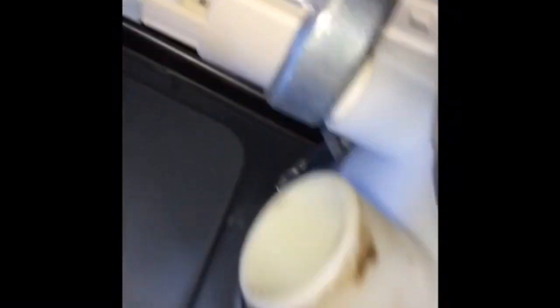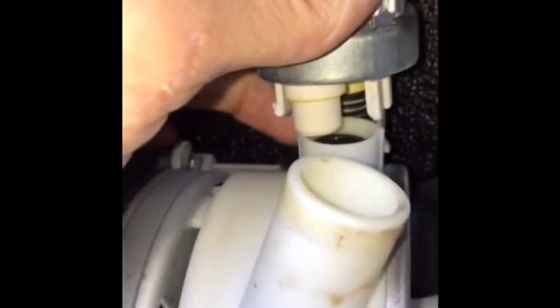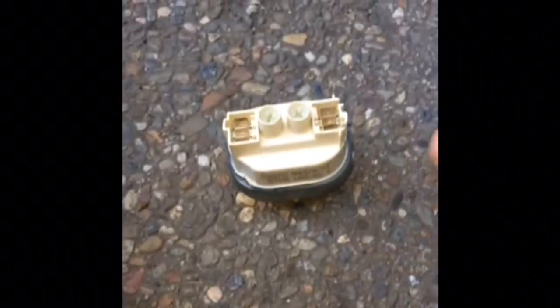With a little bit of pressure you're going to lift it up off of the motor. We'll go to the other side and lift the heater pressure switch off. We can then remove the green ground connection and also remove the four-wire modular connections on the top. These are the ports where the pressure sensor sat — just making sure there's not a lot of junk caught in there. It looks pretty good, pretty clean, so in this case I think the motor is just getting old and not creating enough pressure anymore.